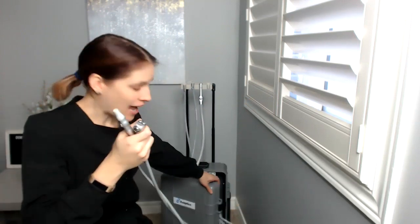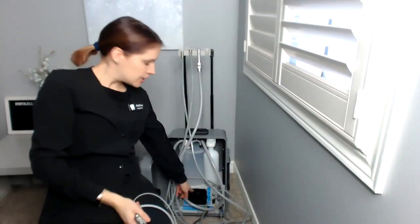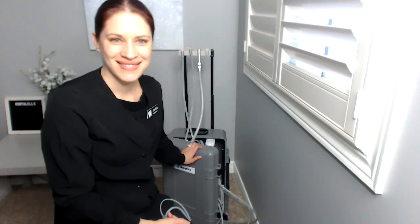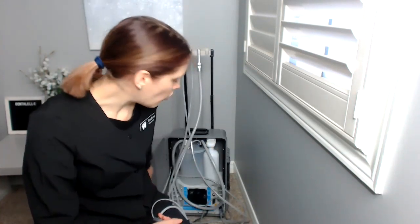Make sure the cords aren't tangled before you start. And you can close the lid a little bit — but don't close it all the way because the compressor fan, this large black thing, needs to move and the air needs to circulate. So don't close it all the way — close it a little bit. It kind of makes a difference. I'll turn it on again for you so you can hear — obviously not a huge difference with the lid, but it does matter for the fan.